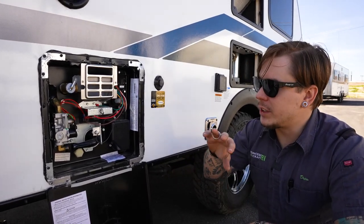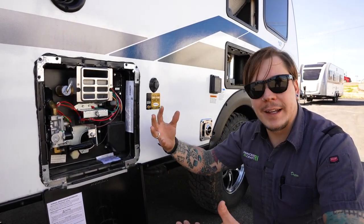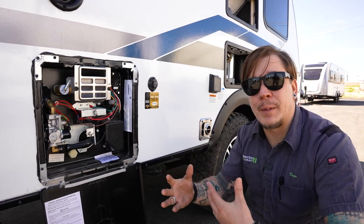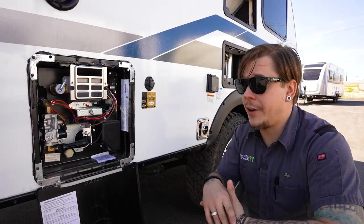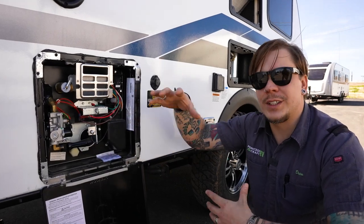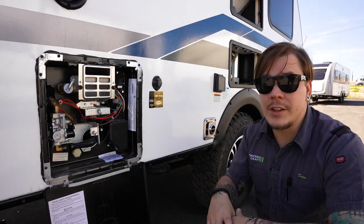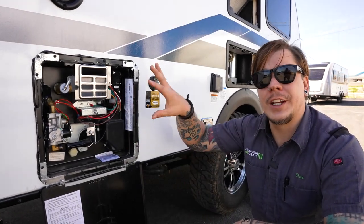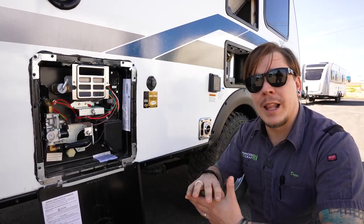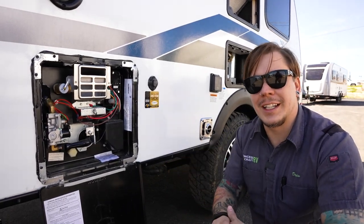What it's doing is, of course, displacing the air that has now filled the tank, replacing it with water. That flow is going to be very spitty, very interrupted, very airy. As the water content increases in the tank, that flow is going to normalize. That is your indicator that you do have 6 gallons of water in the unit, is that the flow normalizes. Once it has normalized, you can go ahead and choose your source and start heating that water.